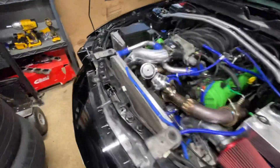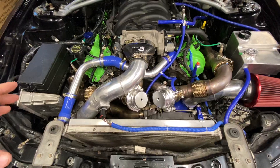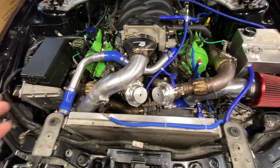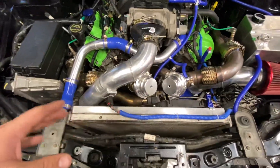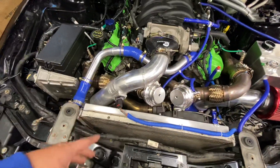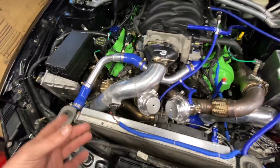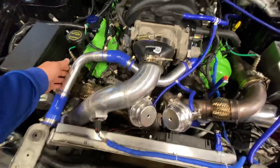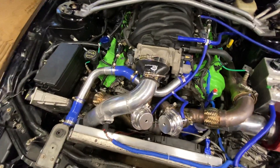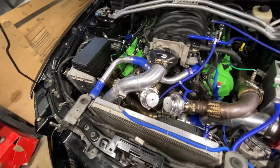There's another thing I'm forgetting. With the kit, the coolant — this car is a 2008, but the kit is designed for 05 through 06 because it has a bunch of stuff routed differently down there and over here. So that was irrelevant to me. I had to take whatever pipes and couplers I could find and make my own coolant routing. It's not such a bad thing — it worked out, it doesn't leak, no issues.